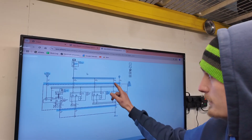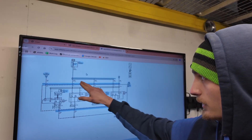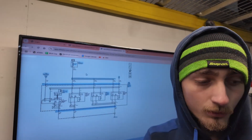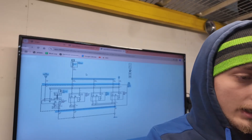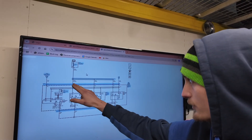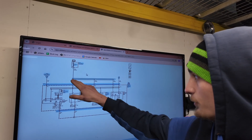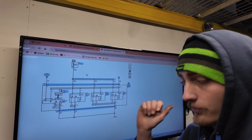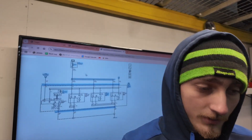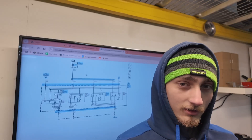What I'm now going to do is load test the three voltages coming in. Because I know we've had a look for damaged or corroded wiring, but this is the definitive answer as to the integrity of the wire - our power wire coming down. So what we're going to do is go to these three pins on both of the plugs. I've got the load tester out and we'll run through that, see what it's telling us.